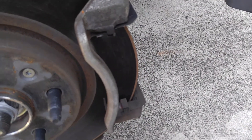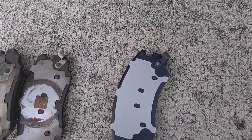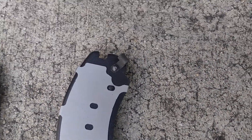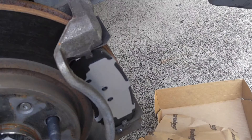Compress the piston and install our new brake pads. For the inside pad, make sure the wear strip is on the same side as the old one. This is our inner pad. Now we have both new pads installed.